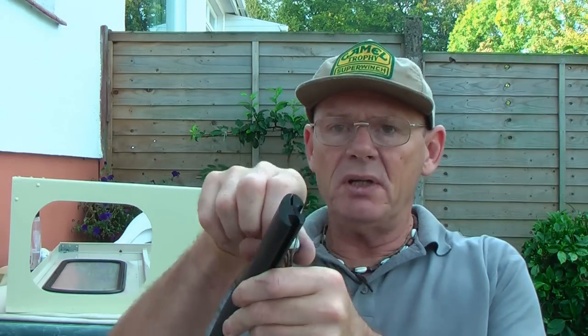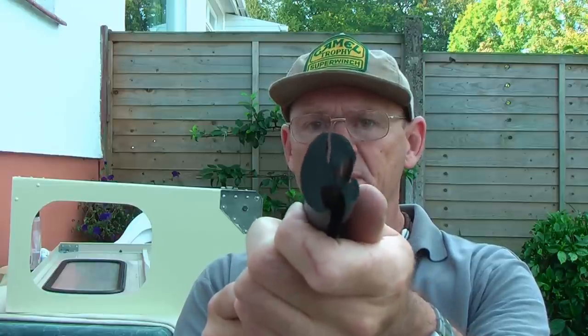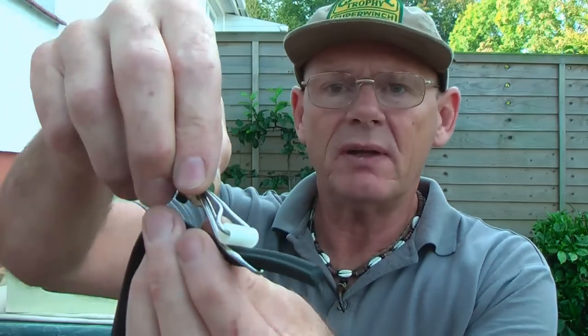I've purchased new rubber seal, as you can see the cross section there. I had to order a special 6mm one from a proprietary rubber moulding extrusion manufacturer and they sent it all to me. As you can see when I demonstrate later, you put that in the groove and insert the locking strip, which helps to push that into the groove to lock in the new window.